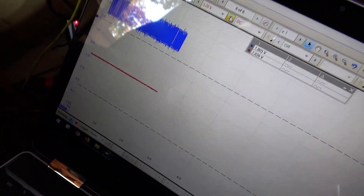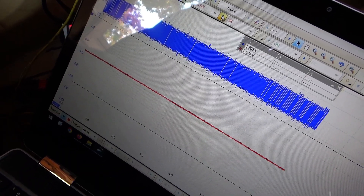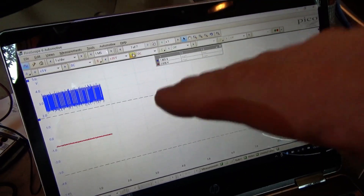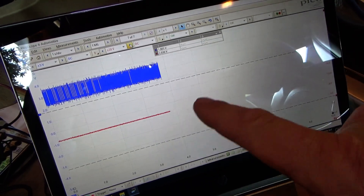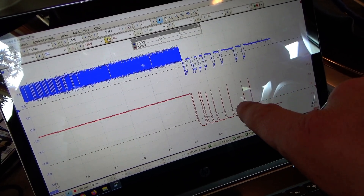The voltage stays even after unplugging the test light — how is that possible? So the question is: is it an internal module fault or is there still a potential wiring fault? And right there it started glitching again — this is a cool capture.